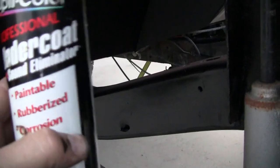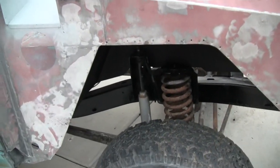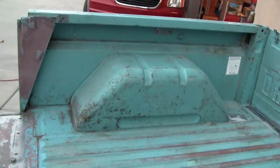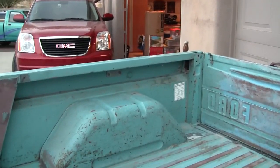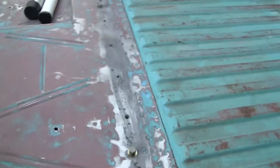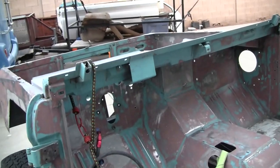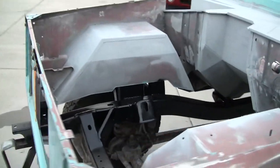The undercoat was the Dupli-Color professional undercoat and it did a good job. I'm pretty happy with how it works — I'm going to maybe hit the seams again. Today's the first day we're actually putting things on and doing final paint. So this week I'll sand everything down, get it ready, get it all taped up. My brother came over and asked me why I didn't sand down the bed — that's because we're lizard skinning. They said you only need to scuff it. So once I have everything painted from the seam forward, while that's doing its thing, I'll come back here, hit that with the old scuff pad and rough it all up for final lizard skin paint. That's where we're at — thanks for watching, I really appreciate it.